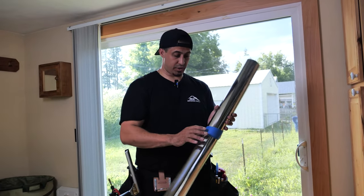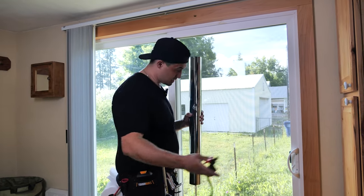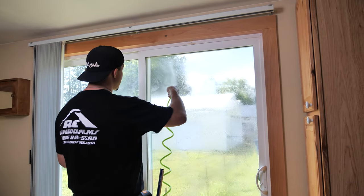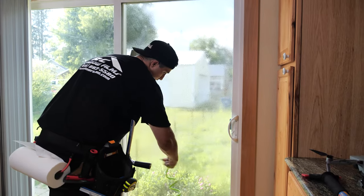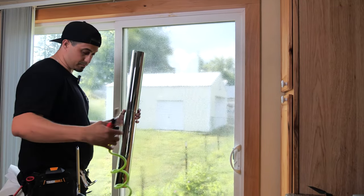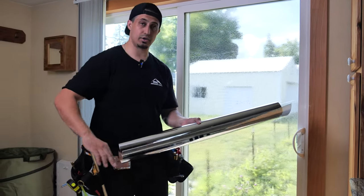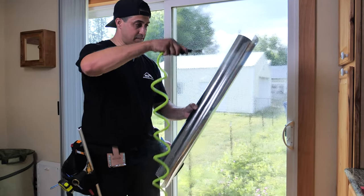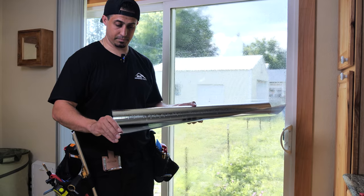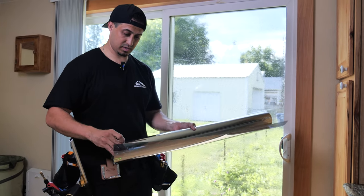Here's my film — it's super thick. We want to be able to spray this glass decently. I like to start but not go all the way to the top, as you saw in the last video. Now, a reverse roll is spraying the inside where the liner is, and then that water creates a vacuum to suck that liner back onto itself.